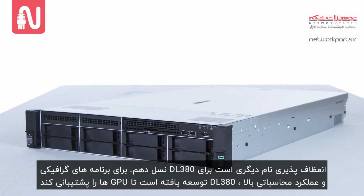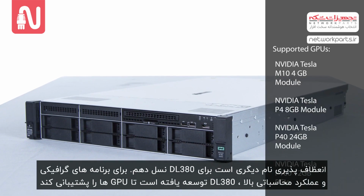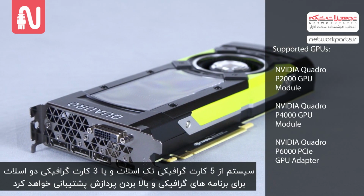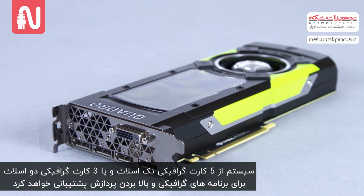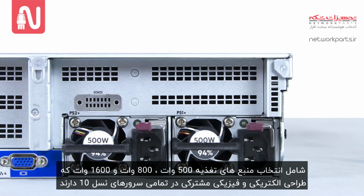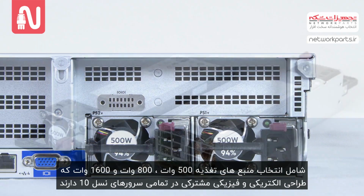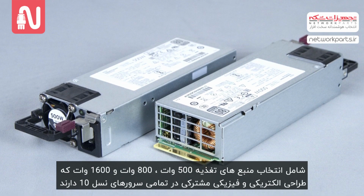Flexibility is the name of the game with the DL380 Gen10, and for graphics applications and high-performance computing, the DL380 Gen10 has expanded support for GPUs. The system will support up to 5 single-wide or 3 double-wide GPUs for graphics applications or enhanced computation. Administrators have a choice of options to power the system with the right size PSU for specific configurations and workloads. Choices include a 500-watt, 800-watt, and 1600-watt flex slot power supplies that share a common electrical and physical design across the Gen10 performance server line.